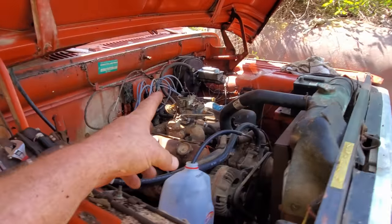Well, it just came a small flood. Yes, sir. Got everything very, very muddy. I did manage to get the fluids in it, though. What I don't understand is online it said a fluid filter change, you need about 5 to 6 quarts. Well, I put 4 in it, and it's that far above full. So, I don't know. We are on a little hill, but not that much. Let me fire it up, put it in neutral, let it circulate and warm up. I'll check it again. And we got to find some level ground because this right here is not level. Might get over there, but it's kind of muddy. Anyway, I'll find a flat spot.